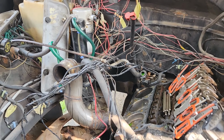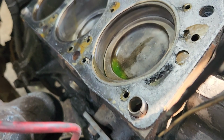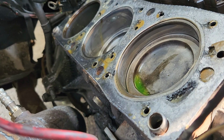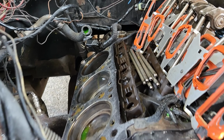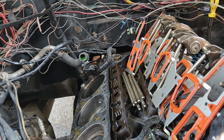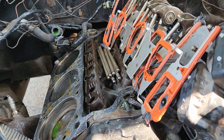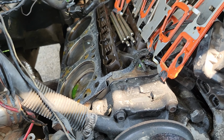Alright guys, so the new turbo works pretty good, a little too good. The wastegate was adjusted a little too tight, and we blew a fuse. Kicked the head gasket right out of it. See, that's the worst spot there. So I don't recommend the $8 head gaskets anymore. It worked for about a year. Did not like the 15 pounds of boost that it saw, or however much it was. My gauge maxes out at 15 pounds, so it might have been 20, I'm not sure. But it was more than the 6 I was running before.